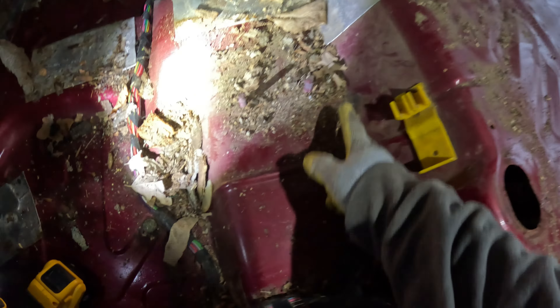Here's the next place to start. You can see a fellow was polishing the fender with his tummy, trying to figure out a solution for this air problem. Every time we hit a mud hole we fill the whole thing full of mud, the mass airflow sensor gets dirty, and it doesn't run so good. What I'm not going to do is spend money on this fix — let's find a cheap, easy, simple solution. I've got a whole roll of duct tape, we can do this. A bigger inlet for performance — here's the finished product, or we'll figure something out. My theory is this is the cleanest spot under the hood, so we could draw air from there.